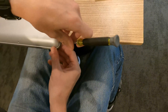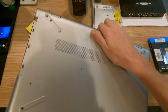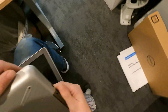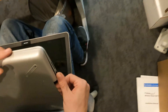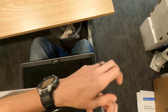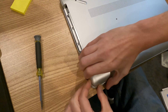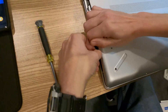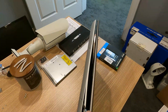They do make a plastic case opening tool, and I don't happen to have one in this video, but you will want something to wedge the case open. Once you get a little bit of a wedge into the case and start prying it open, you break the snap clips — well, don't actually break them, but you're going to disconnect them. You can start using your fingers, and I recommend just using your fingers and carefully applying pressure. You will have to apply firm pressure to release these snap clips, but use a little tool if you have to. It's going to feel like you're doing some damage, but obviously you don't want to overexert it.